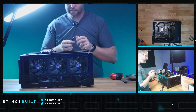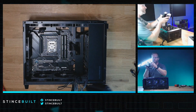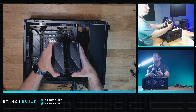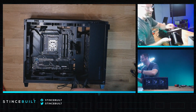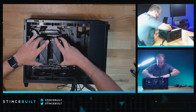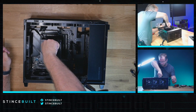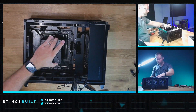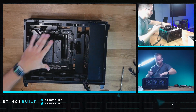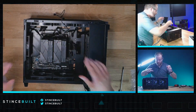Hit our thermal paste. This tower cooler is really nice — seven heat pipes. Holy cow, seven heat pipes on a tower cooler is nuts — this is going to cool a lot. Getting it all clipped in — that's really sturdy, good to see. All clipped in, looks good. Let's get the next fan — let me get the cables together and feed them through.